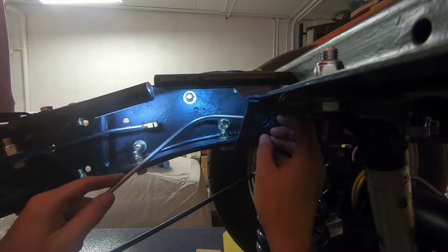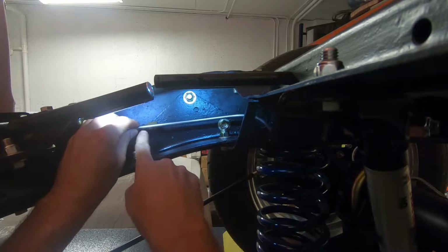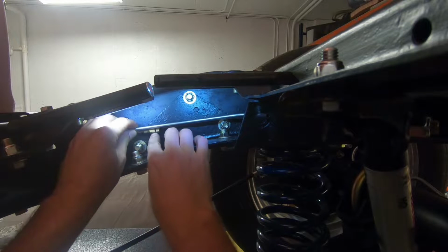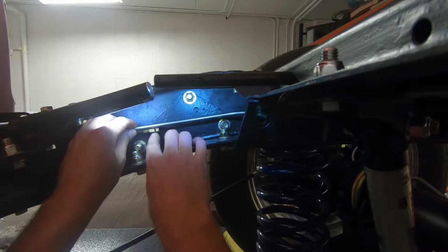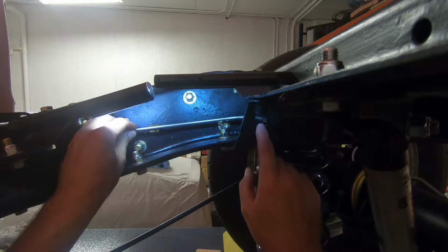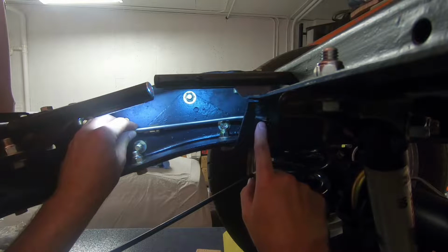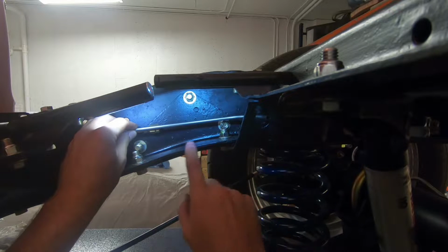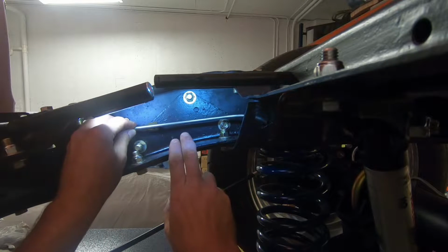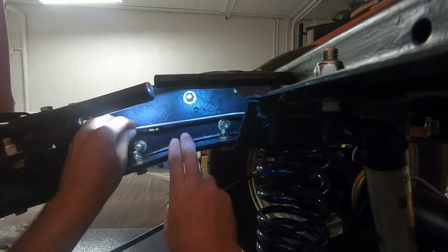So what I've got here is I've got to make a line that goes from here to a fitting here. My initial thought is, I drew a line on here where approximately the tubing will go inside the fitting. So the flare will be approximately there where it mates up with this union. My critical dimension in here is kind of centering it in this opening. I've got a little bit of play in that this is a bend, so I can kind of bend it a little bit and play with it, but that's kind of where I'm at for there.